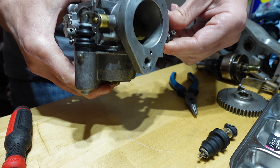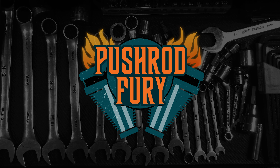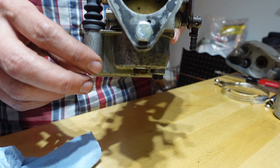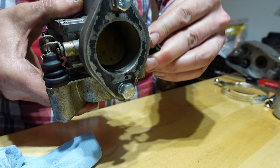It pushes the little pump. Push rod fury! Cut the Bendix carburetor out, take a look. You can see you give it a little bit of throttle — the accelerator pump isn't working. It's missing parts. The last person didn't care all that much. They left part of the gasket, so we'll put some WD-40 on that to help soften that up.